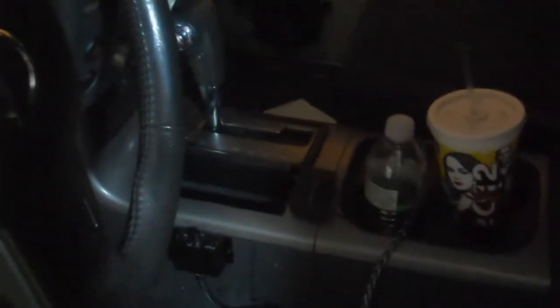I'm just going to show you guys what I did in here. Here's the amp that's going to be sitting under the front seat. I got my RCAs — I had to use an RCA splitter, two actually, because there's only one speaker output RCA on the deck here. It's all apart right now. The other one's a subwoofer out, so I plugged the subwoofer one into the 3 and 4 channel in here, and no sound came from it — the speakers were moving, but there's no actual sound. Something always goes wrong, something always comes up and makes it difficult.